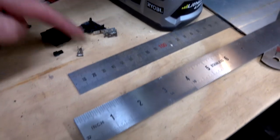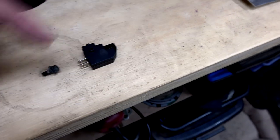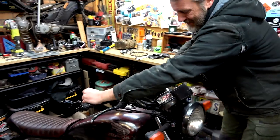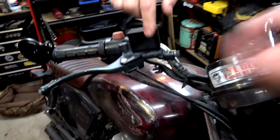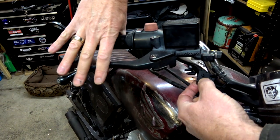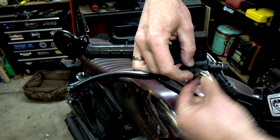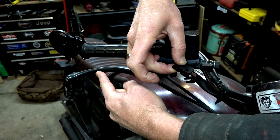So this is the remnants of the old one. It basically exploded, and this is the new one. We've got to put that with that screw and we're done. Now just for shits and giggles, this switch - when you activate the lever, it pushes that down. When I was playing with the other one, I couldn't work out why - you'd press it in and it would turn stuff off. The reason is, this switch sits in behind there so when you press that, it actually comes away. So that switch is pressed in the whole time until you do the lever and then releases it. So it's a reverse switch.